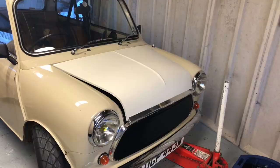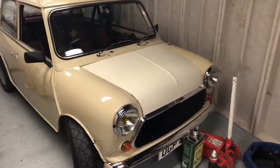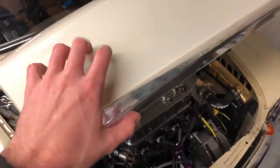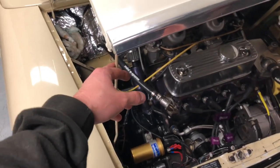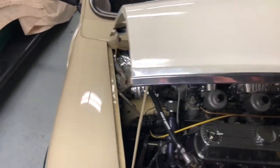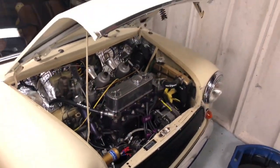All the way on — just got to align that one now. We've got a new face. It's sort of shut — it's definitely not fully shut. Rust free! One new bonnet. It is adjusted so it fits and closes, but I'm not going to fit the stay. I'm not going to play around too much with the adjustment — I'm not happy with it basically, because I'm going to get the vertical hinge kit ordered and get that fitted.